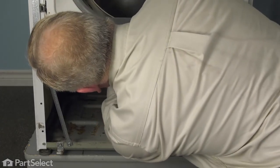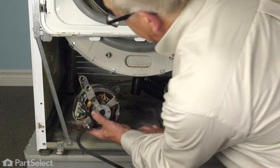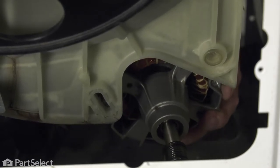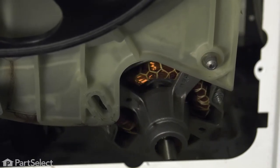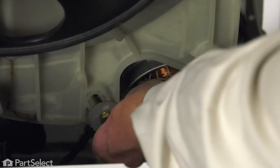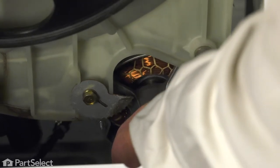Make sure they're pressed firmly into place and are flush with the mounts. We'll then take the new motor with the harness and we're going to line up those pins with those mounting grommets. We'll line up both mounting pins with the grommets and push the motor fully into position, and then we'll tilt it up and reinstall the mounting bolt. Just tilt the motor up until you can see the threaded hole in it, just clearing the bottom from that slotted opening. Once we have that bolt started, go ahead and tighten it up a little bit. You'll want to rotate the adjusting washer completely away from the stop guide on the back of the tub because that motor will end up being snug right up against it.